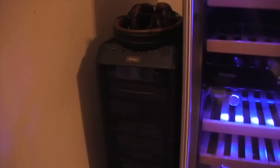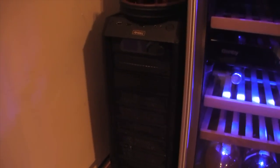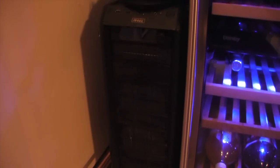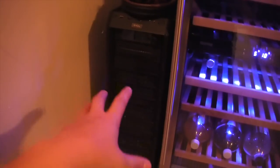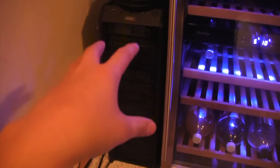Over on this side we've got a server. This is my previous build — part of the 2011 build — and it is a beast still. It has a 6970 graphics card, Maximus 4 Extreme motherboard, 2600K clocked to 4.8 GHz, and cooled with an H100. Right now I'm using it as a storage and processing server — anything I need to offload, I offload to this machine. It's currently off, but I'm just missing a couple hard drives, so when it's on it's going to run 24/7.